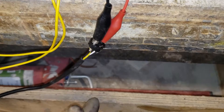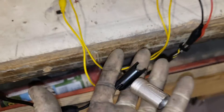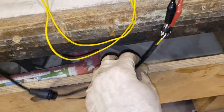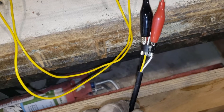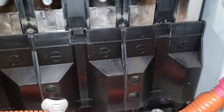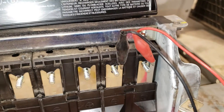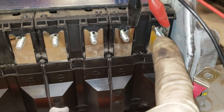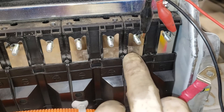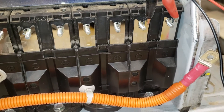The plug that it comes with is set up like an e-bike charger, so I just disassembled the plug and put jumper cables on it. What I found was black was negative and white was positive. Luckily on these cells they are actually individually labeled negative and positive. On this battery these posts themselves are not the terminals — it's these flat blades, those are the actual terminals. It's very strange.